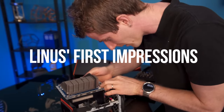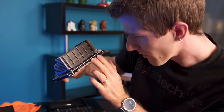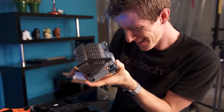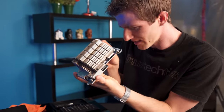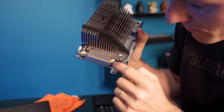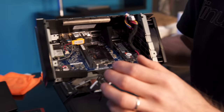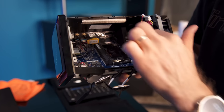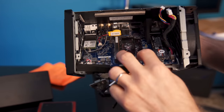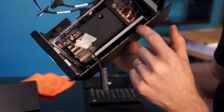I just broke a small thing, but it's okay. It's actually a pretty beefy cooler for a 1060 too. Fully custom GPU — there's the dual mini DisplayPorts, there's the dual HDMIs. Memory is under a heat pipe over here, so the memory is here and here. Everything about this thing is custom down to the printing on the VRM modules. Expandability is really compact in here: you've got one M.2, then another that runs either PCI Express or SATA M.2, your two SODIMMs, and you can actually install a 2.5-inch drive here as well.